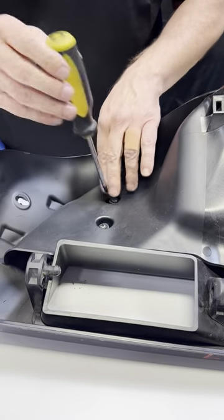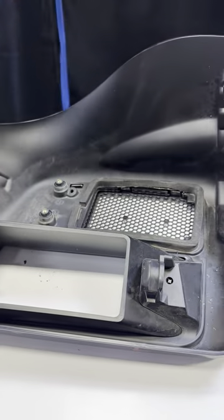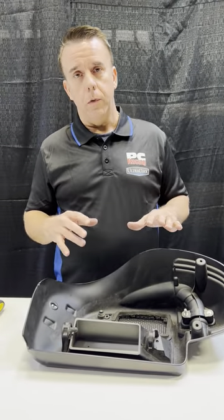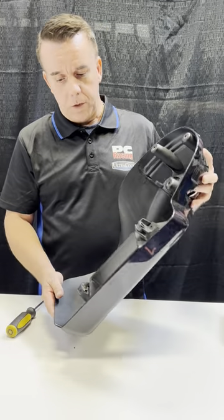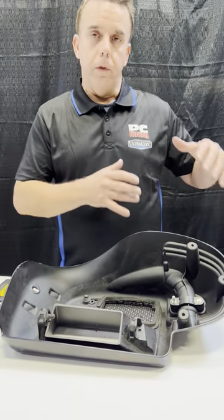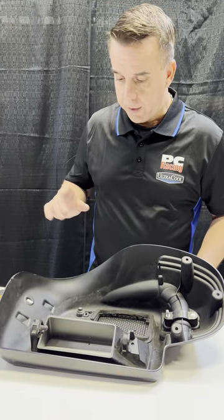So this whole piece comes off. You will see exposed — if it's liquid-cooled — your radiator and fan. All that stuff is going to stay on the bike. You're not going to have to disconnect the radiator or the water lines. They'll kind of hang on the bike still. Once you get to this point, I'm going to show you how to finish taking it off the crash bar. You'll pull this lower fairing off, install the Ultra Cool oil cooler after we make the cuts, then put it back on, all leaving the water cooling intact.